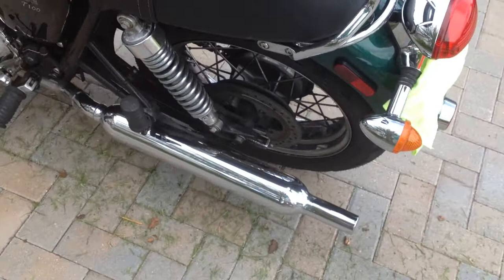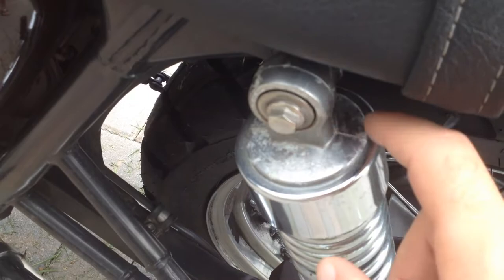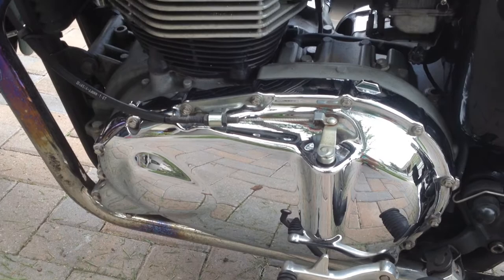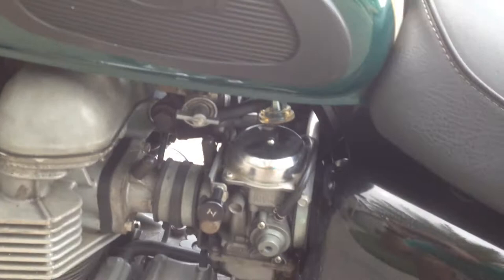There's chrome on the other side with these pipes — again, the buildup, as you can see. It's just on the top part for some reason. Battery covers and everything, and then the chrome on your engine cover on this side, looking good, everything's good to go. When I bought this it had a fuel filter in here — a different fuel filter that had a buildup of fuel sediment — so I put a new fuel filter in there that connects to the petcock here. This is a carbureted version; this is the last year they had the carbureted versions of the Bonnevilles.